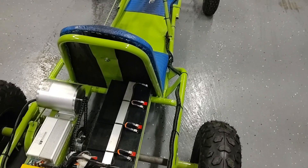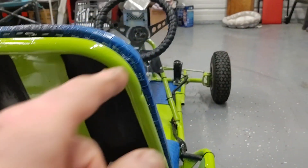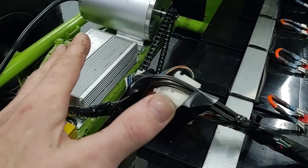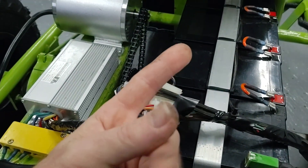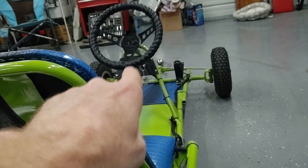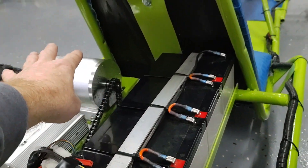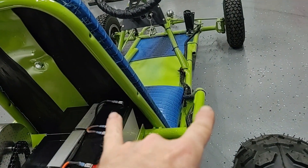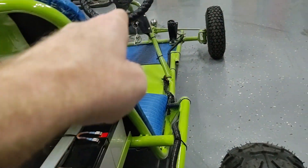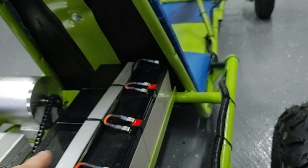You may have a few more that you may or may not use. One of mine says 'Indicato' — I guess that's like indicator — and what it does is sends out 48 volts when you turn your key on, so you could run it to a light that would tell you when it's on. Another one of these wires is brake. I had two brakes: one said 'brake' and one said 'braking.' Brake is basically made for a brake light. Braking is the one you run to your pedal, and what that does is kill power to the motor when you hit your brake — it doesn't actually put brakes on the motor, but it kills power so that if you're accidentally pushing the gas and the brake, they're not going to fight each other.